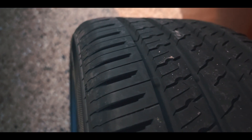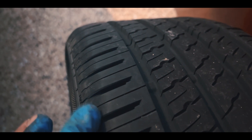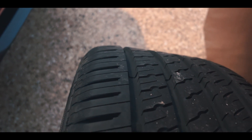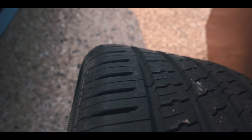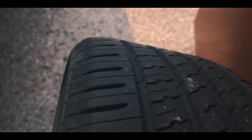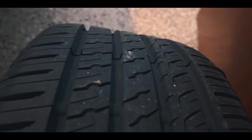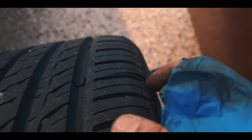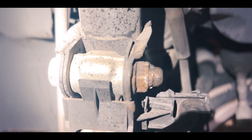As you can see, this tire is fairly new but it's already kissing the corner right here — you can see the dark spot on the corner. This tire probably has less than 100 miles on it. That's exactly why you need the camber kit on your CLA. This bolt comes with a glue or some kind of protective film on it.